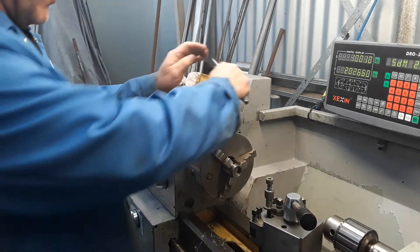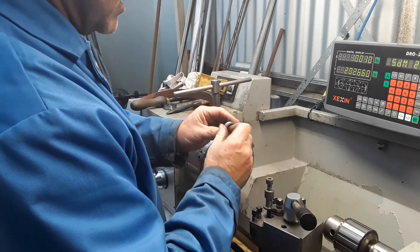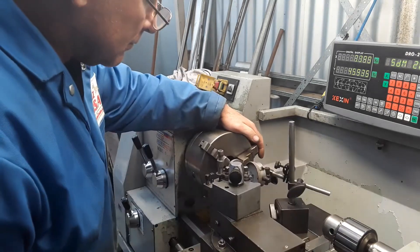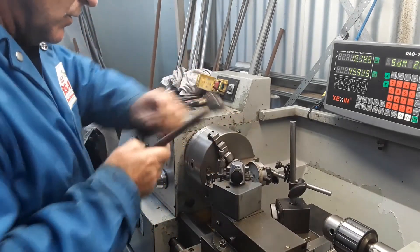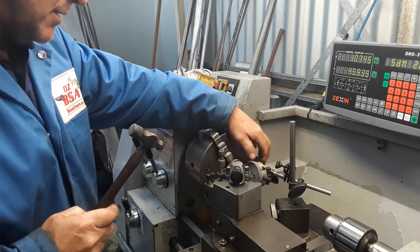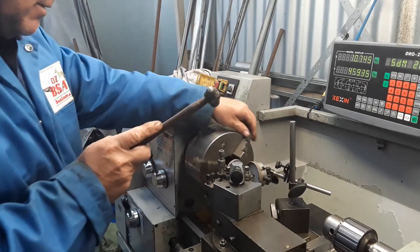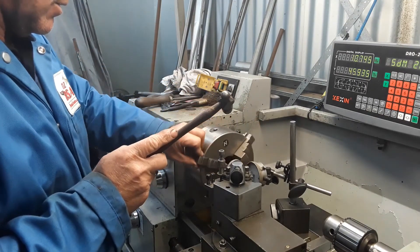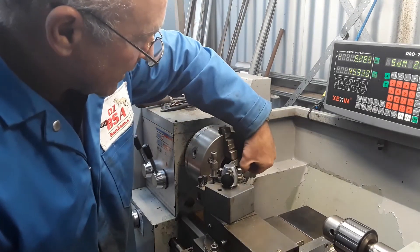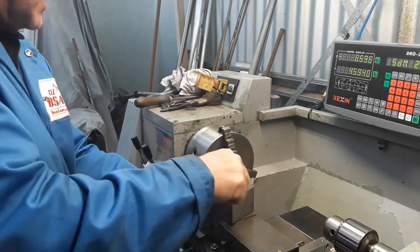The other thing — and I've already done it — is where your sprocket bolts up to it, you usually get a burr on there. So I've just gone around and knocked that really sharp edge off. Now I'm setting up the crankshaft distance piece and getting it running perfectly true. We've got that running true and now I'm going to machine the face of this off to take the groove out of it, and I'll do another back cut to give clearance for the bearing along here.